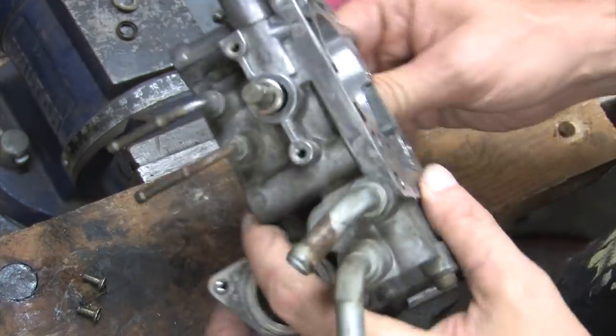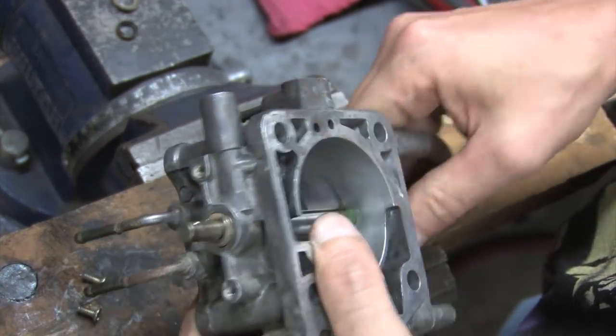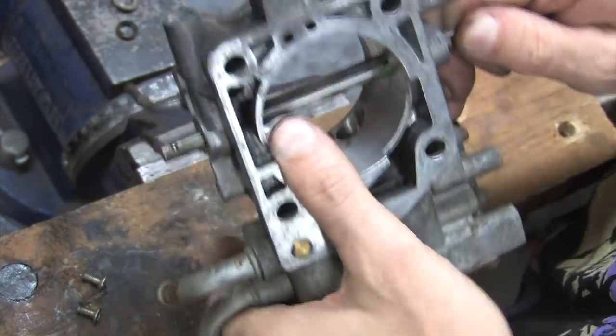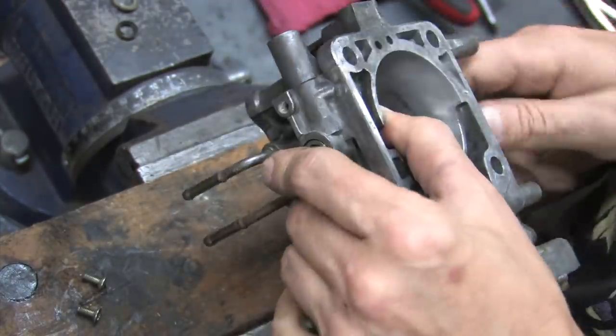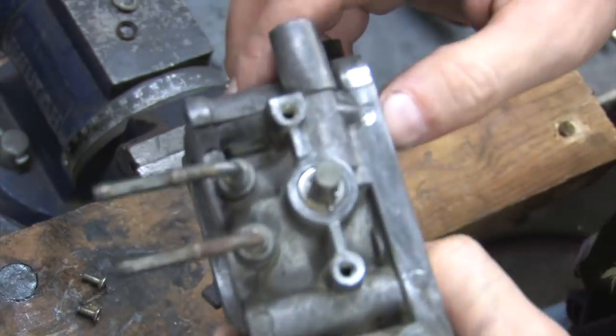All you have to do to install the seal is pull on the throttle linkage side while turning it, and then press on the TPS side while turning and pulling on the throttle linkage side. The throttle shaft keeps the new seal centered while the washer stack and its specific thicknesses press all the parts into the bores. The parts themselves are the seal driver.